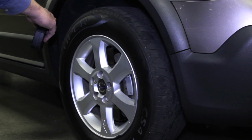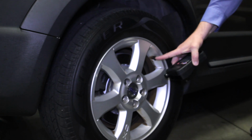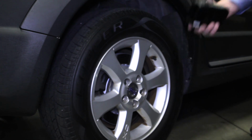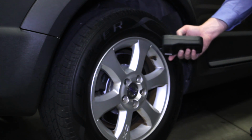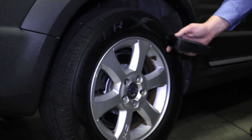Let's move on and read the right rear. Now that we've moved to the right rear, interesting, we have another rubber valve stem. This may lead us to what is the service issue with this TPMS system. Let's take our tool and attempt to read this sensor. Again, no audio, but a message, no sensor detected.